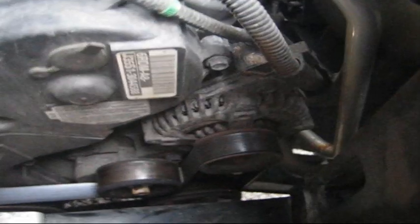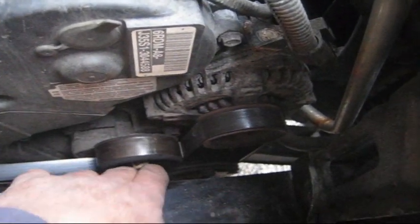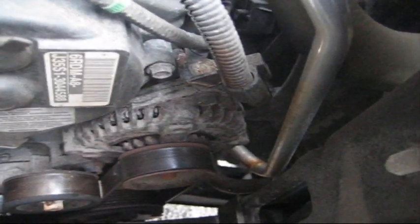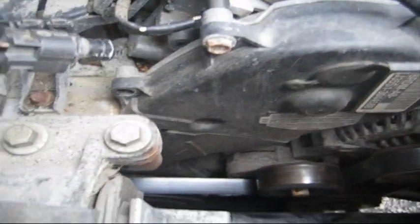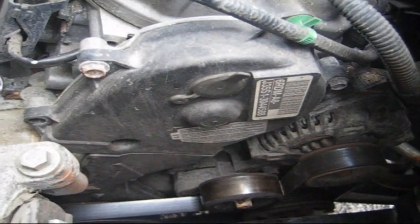Now we get to the alternator. The first thing I'm going to have to do is pull back on this tension pulley to get the belt off. To get this alternator out, I'm going to have to get the bolt out of this motor mount, get under the engine, and jack up the engine a little bit. This tension pulley has to be held up and this engine has to be propped up somewhat. To get this alternator out, we have to bring it up somewhat, and I may have to take the cover off this timing belt housing for a little extra space. I'm going to take as little off as possible to get to that alternator.